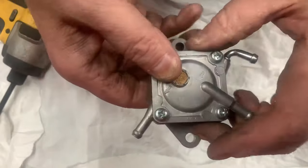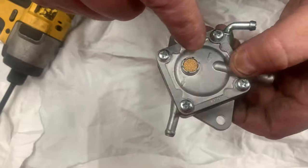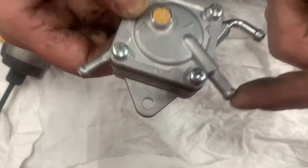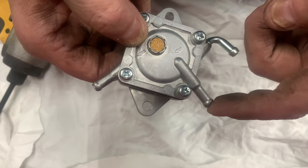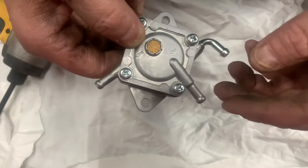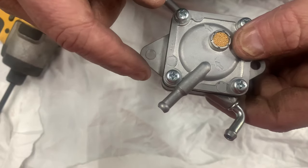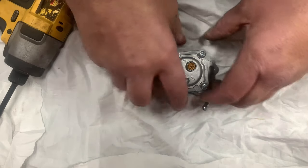I hope this demonstration on this Mikuni style fuel pump helped you out. If you're getting fuel out of the vent, you are going to get fuel into your crankcase from the pulse line. If you've got gas in your oil, check this and check your carburetor needle and seat. If the needle and seat on your carburetor is not working properly, it's going to flow fuel right from the carburetor down into your cylinder — and all that gas is going to leak by the rings, or depending on which position the engine is in, you could have the intake valve open and fuel can pour right down the valve guide as well.